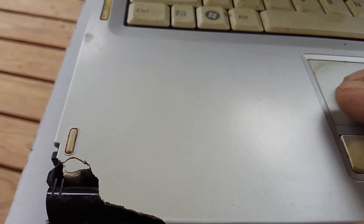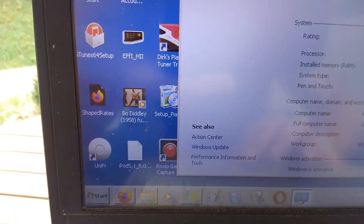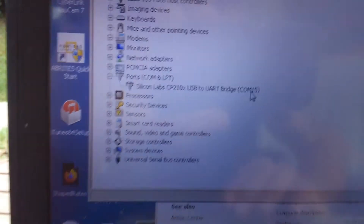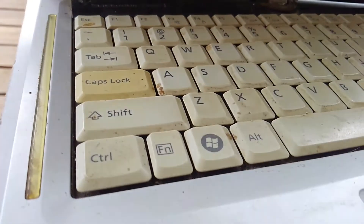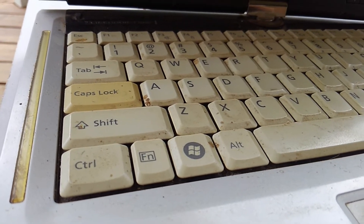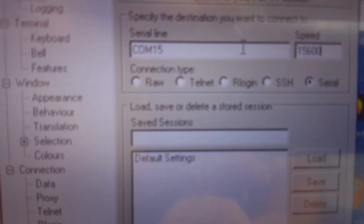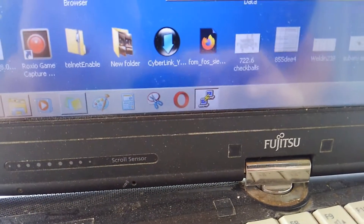Go into your computer, right-click and go to Properties, then bring up Device Manager. Figure out what COM port your device installed on — mine is on COM port 15. Close everything back out, open PuTTY, select Serial, COM 15, and set the connection speed to 115200. Make sure you put that speed in, select Serial port, and click Connect. Once it comes up, just hit Enter.